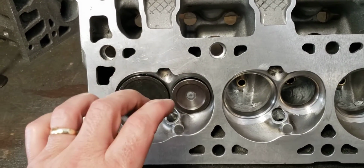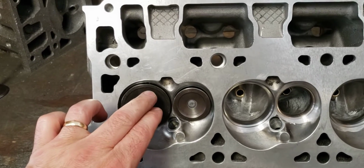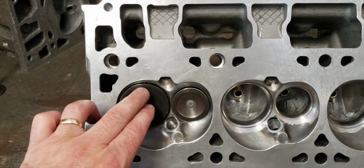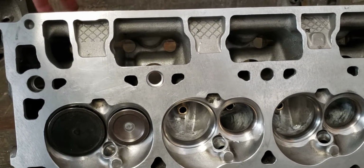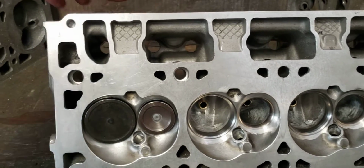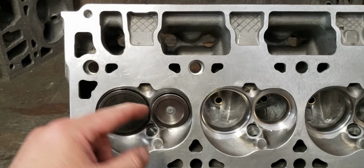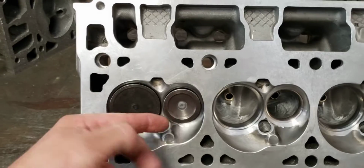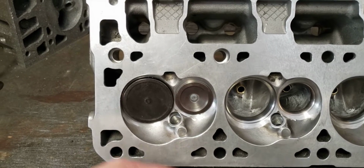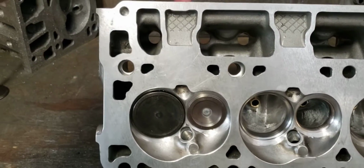Now, this cross section, as the valve is being pushed this way, you do have a propensity for backflow. However, again, like I said, with the other cylinders pushing, it's pushing pressure just a little bit, not much, on the back of here, helping this come through. But our main effort is, since the air is already being forced this way, it's going to want to continue to go that way. So as soon as this shuts, the piston is now traveling down. We've created force starting this column of air.